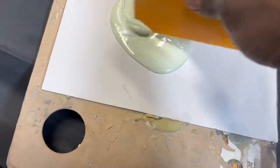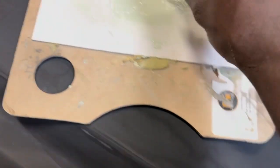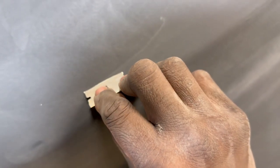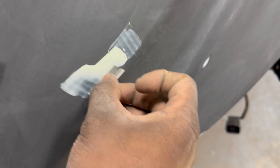What I'm doing here is mixing up my putty — just mix it real nice, put a little bit so it dries slowly. Then literally take a razor and just scrape it over that little peck right there. I'm filling in that little rock peck with that putty. See over here again, that's a little rock peck — filling it in because what I don't want to do is try to feather edge, because when you feather edge it just winds up making little craters and grooves.